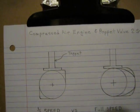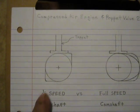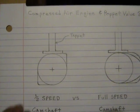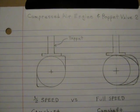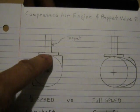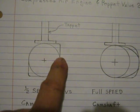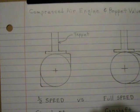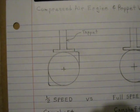Here on the left we have a standard half-speed camshaft, but this one has double lobes on it. What I'm trying to show is that when you only have 180 crankshaft degrees of duration, you can only have a short valve lift as well as limited effect duration — and you need two of them. This would be like on the exhaust valve of a compressed air engine.